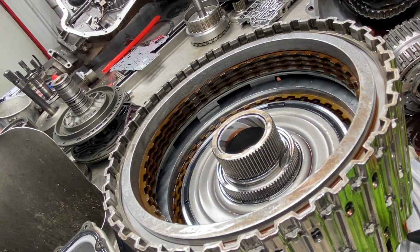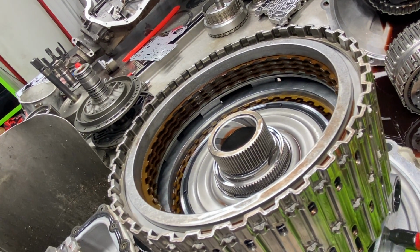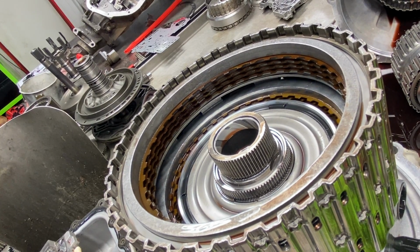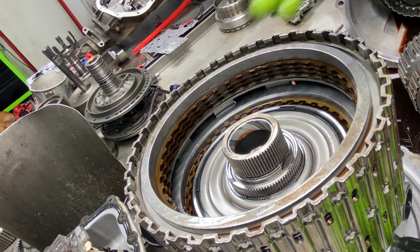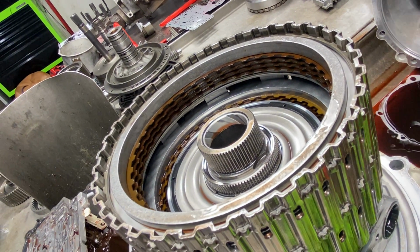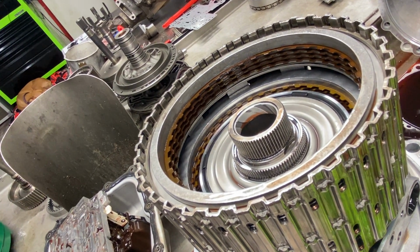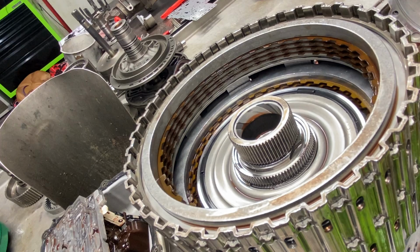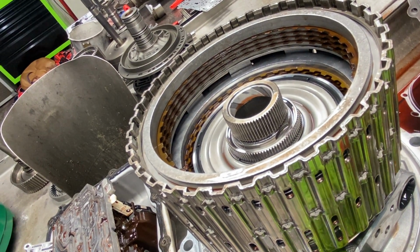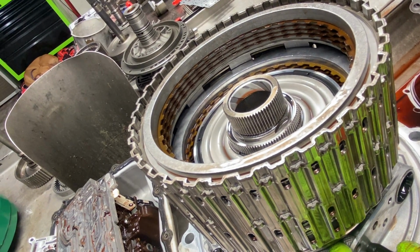When I blow air in it and let go of the trigger on my air gun, it stays applied. That tells me that there's no crack. See that? That's a tight sealed drum right there, guys. That's common for a slow leak down like that. But if it's cracked, it'd just fall to the bottom. There would be no slowness about it. Now you see here, our three, let me hold it a little tighter. See how that holds really nice too, falls down to the bottom slowly.